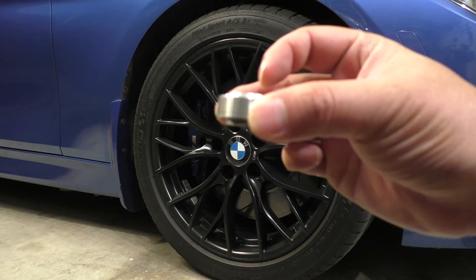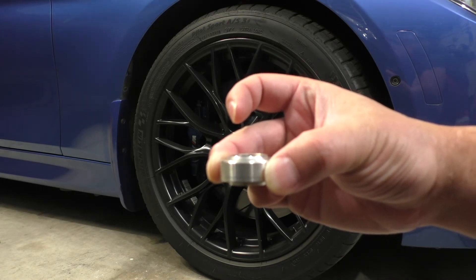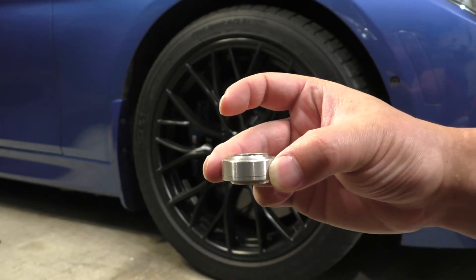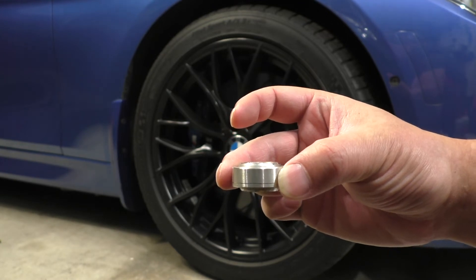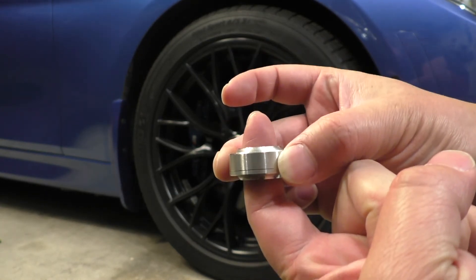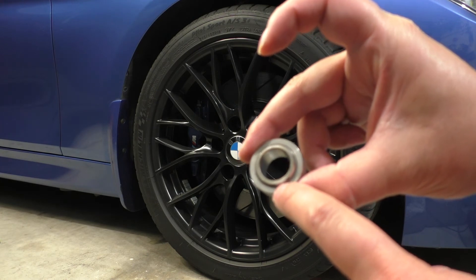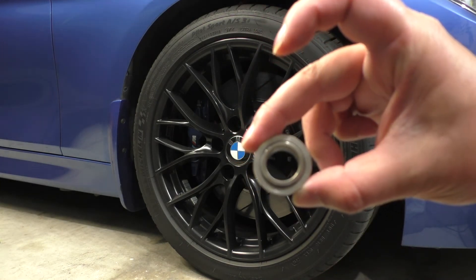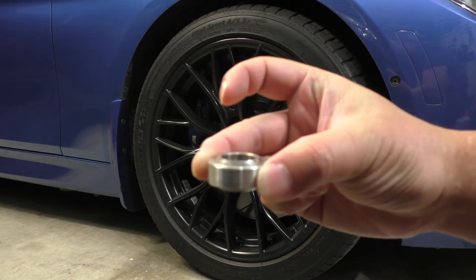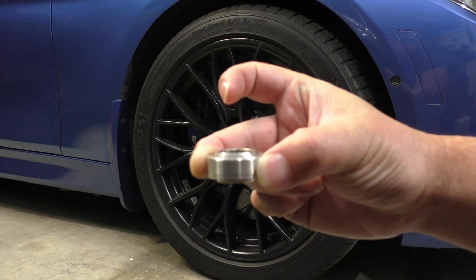As we're looking at it from the side, you can see the wall housing is really thick on the side. This is really the way these bushings are supposed to be loaded — they're supposed to be loaded to the side. When loaded to the side, you have the whole height of the housing supporting the load. When installed in a camber plate application, though, we have the piston shaft going through, and as your damper moves up and down, instead of loading side to side, we're now transferring the load up and down. If you look at this thinner wall, it has to sustain all of the load. That is why these guys wear out in camber plates and start making noise — because they're not being loaded the way they were designed to, and there's much less area supporting the load, so those load-bearing surfaces wear out sooner.